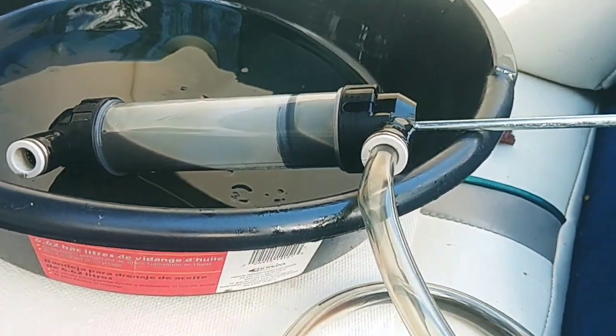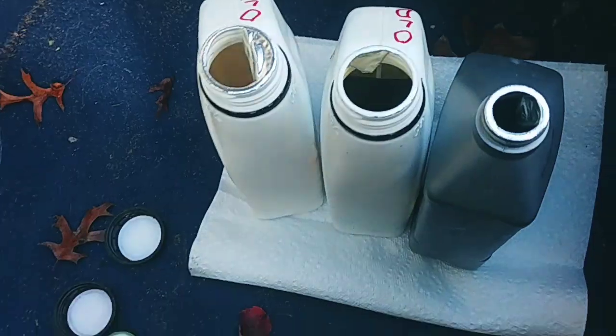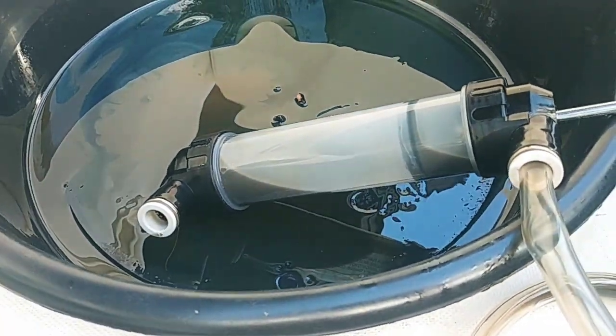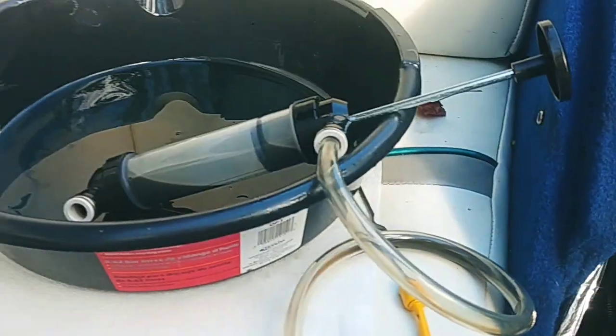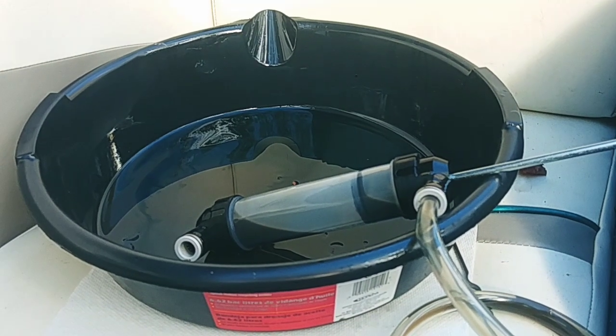For this, I got this pump and attached the top to this hose — it just goes right over the dipstick and fits perfectly. In the bottom, I'm actually going to pump it straight into here. You can see I already started pumping and have a little bit of oil coming through. It moves pretty quickly once the engine is heated up. I just want to pump what I can into here, and when it doesn't fit, I'll put the rest in an oil pan. That was fantastically easy.